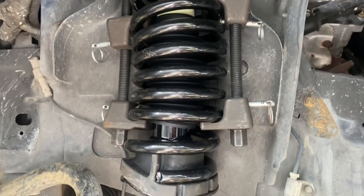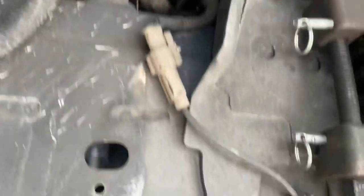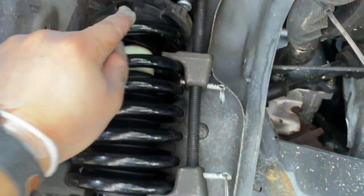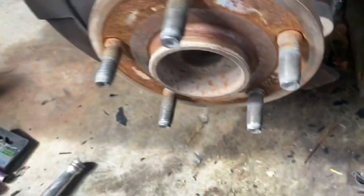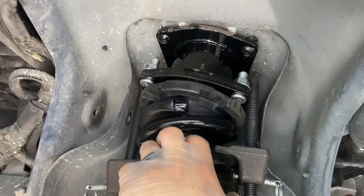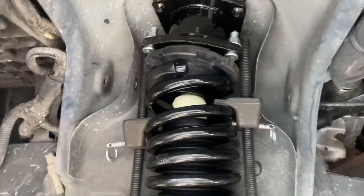The progress on this strut has been a little more than unexpected. I had to take out that upper control arm splash shield to get to the bolts — the nuts on the other side of that upper control arm, which I believe are 18 and 19 mil. I had to compress the spring to get it manageable, decompress the shock. I put the jack underneath that wheel bearing hub — this Harbor Freight jack — put this plate right under there, lifted it up, and then mounted it and hammered it to slide into that hole. You will have to take out that upper control arm to make it easier.